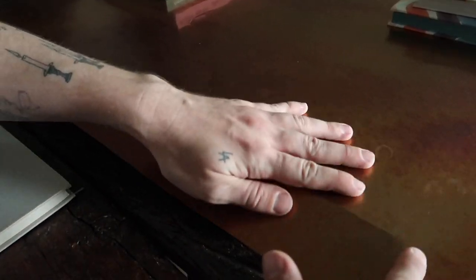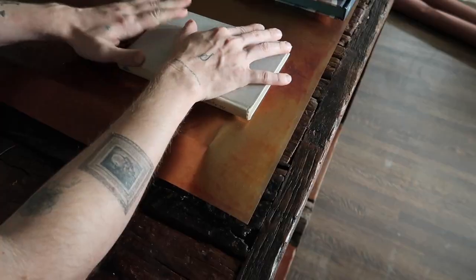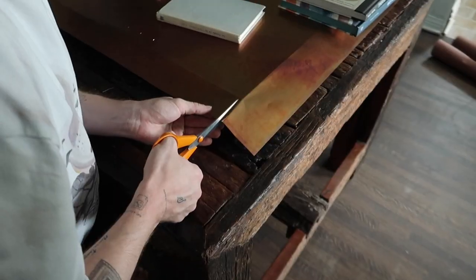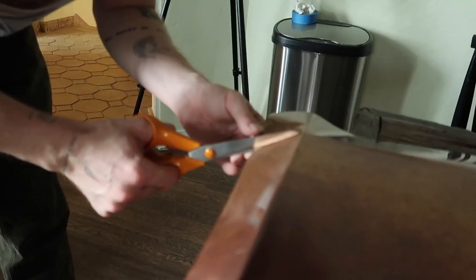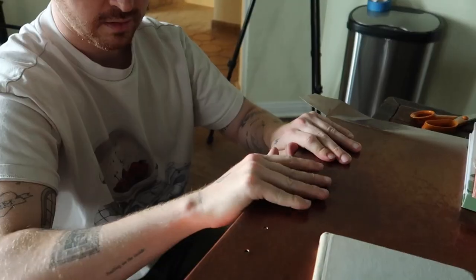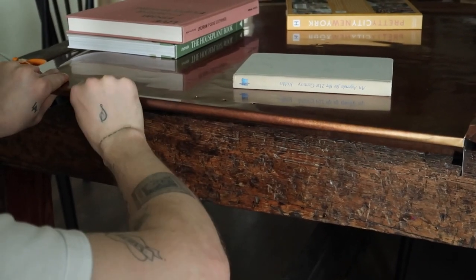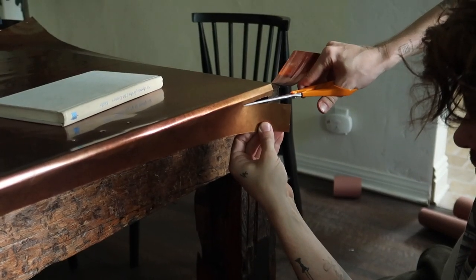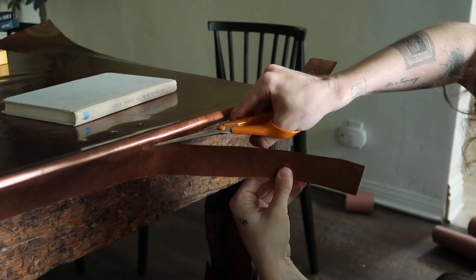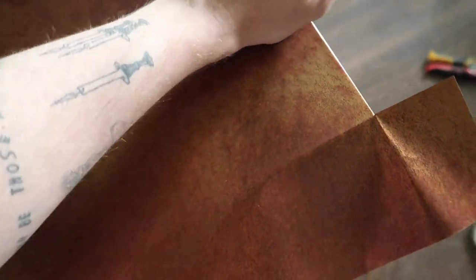This here is the top edge of the dishwasher, and I'm just starting to kind of fold this metal. I want to find the corner, because I need to cut up to it. Using this book to press across the corner and press it down. I created this line here and I'm going to cut about a quarter inch down — this is actually going to be sandwiched back in when we attach it back together. I'm going to mix some epoxy on top of this packaging, then apply it to the underside of the flap and clamp it to dry.